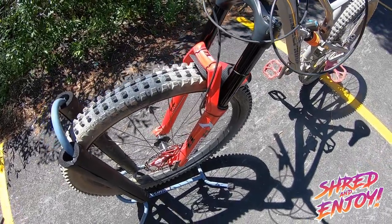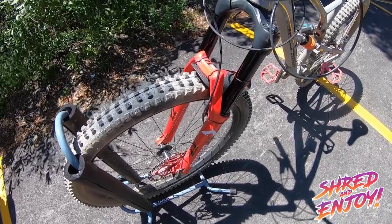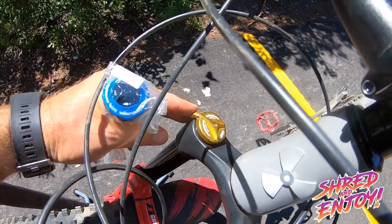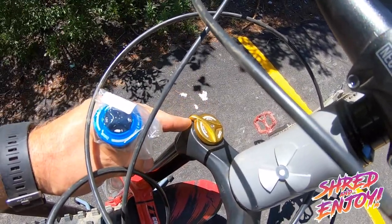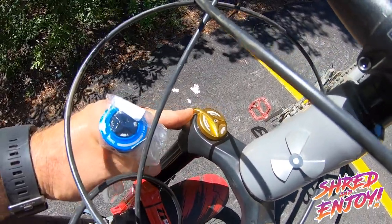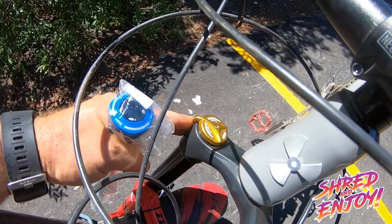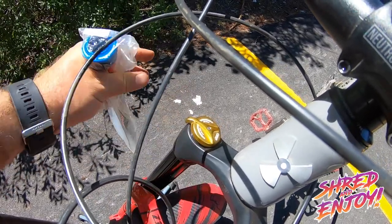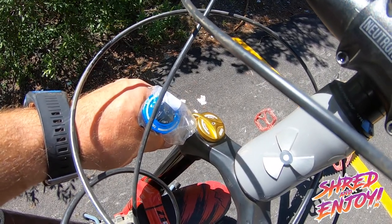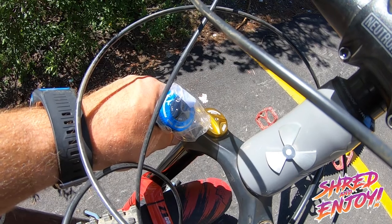Done with a few laps at Ski Bowl. Took the Marzocchi Bomber out, got into some tech, had some fun. One thing I do like about this Grip Damper is it's super easy to change your position. I kind of know where I like it — softer is easier, not as harsh on my hands through tech. A little firmer tends to be better in some other places, but when I go firmer I just don't have that bottom-out control I'm looking for. That's where the Grip 2 will hopefully allow me to adjust low speed based on where I am, while keeping that high speed compression and rebound adjustment for bottom-out control.